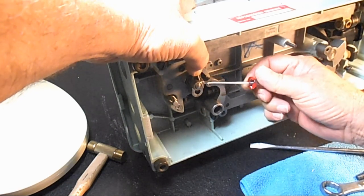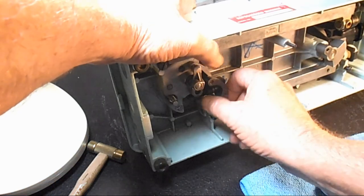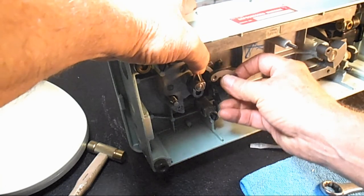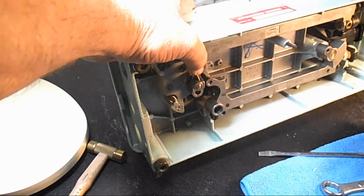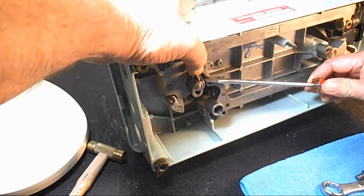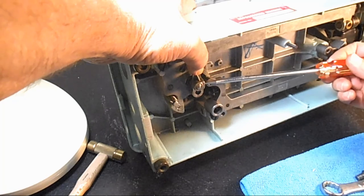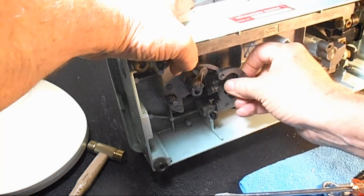And wiggle that around to be sure I'm in the groove. And now when I move it, I see the timing marks moving with it, so I know my set screw is in that timing mark. So I'll take my bigger screw and turn it in there real good and make sure it's not going to work loose. Okay,